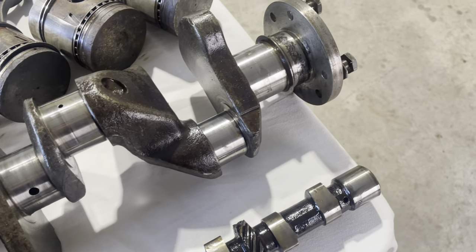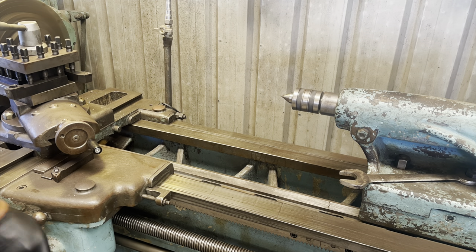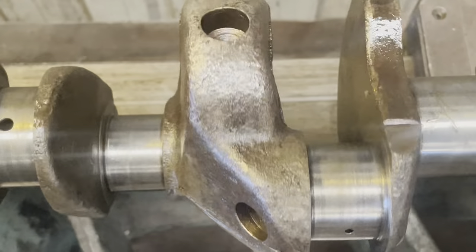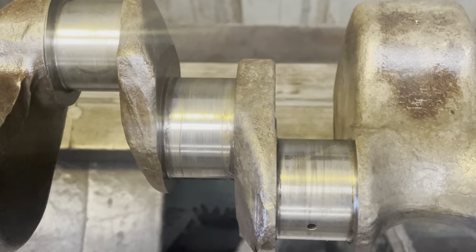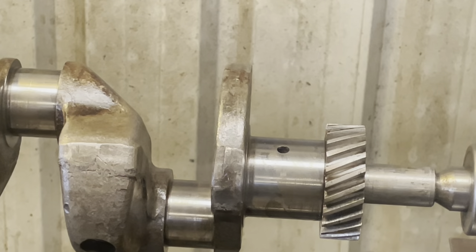I'm not going to use the oversized pistons - I'm going to use those piston heads with these con rods because they seem a bit better, and I'm not sure if those con rods are out of shape due to the spun bearing getting too hot. The plan is to polish this one up on the lathe, just run a bit of polish over it and shine it up before putting it back in the block. She's all set up in the machine - I'm going to use 400 grit wet and dry paper with some WD-40.